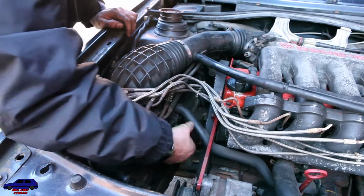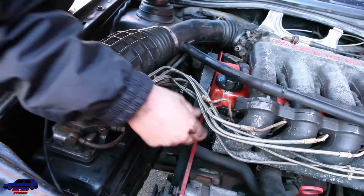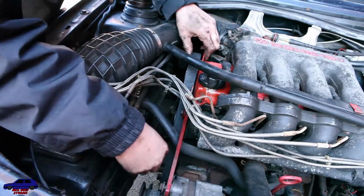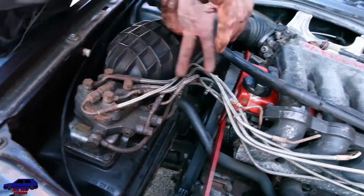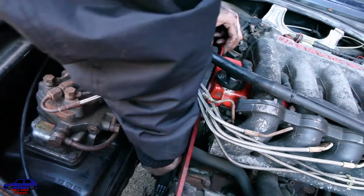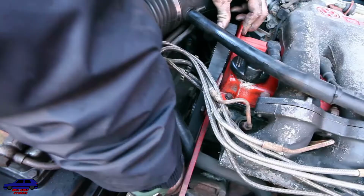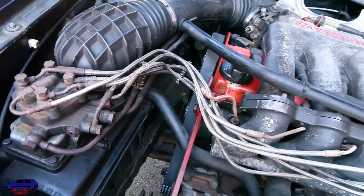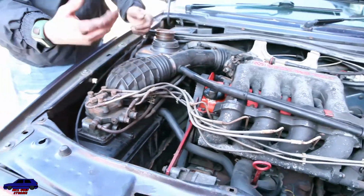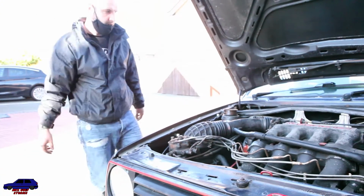It's good that. And what's a good rule of thumb for checking the tightness? In the workshop we'll have a specialist tool that will check the tension. What you can do is the 45 rule: if you can't turn it more than that, then you're good. Lots of people over crank their timing belt and put excess pressure on it. It causes lots of wear.